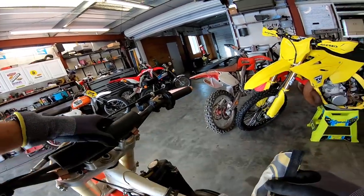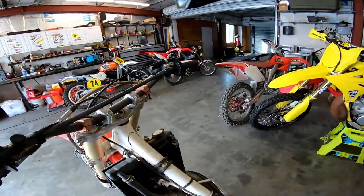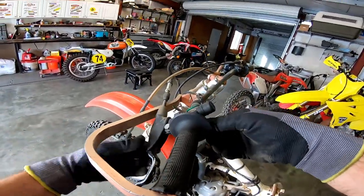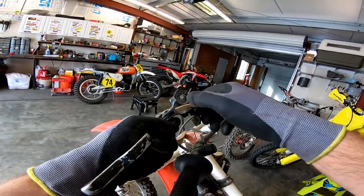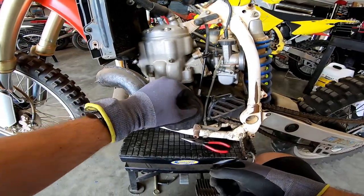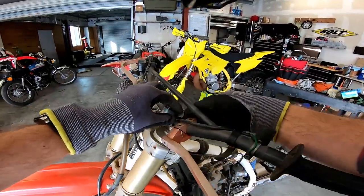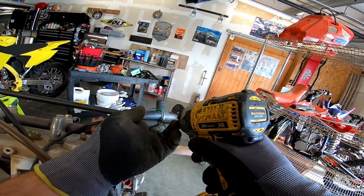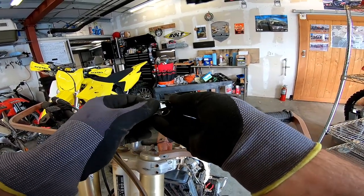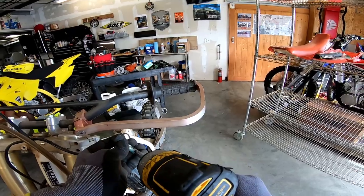Got this super sick 90s Answer bar pad off. It's kind of a collector piece in itself for somebody. We're going to have to open the ignition cover to get the other end of that clutch cable out, and that will require the pipe to come off, so we'll let that dangle for now and get back to that when the bike's up in the air. Move on to the kill switch. Get the Phillips tip, put the screw back where it goes. A lot of times these fall out of the kill switch button — the clamps do. So if you put this thing back up the same way you found it, it should stay in one piece.